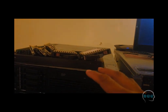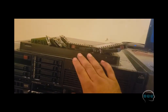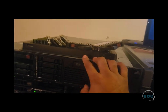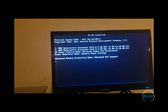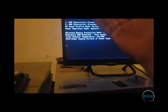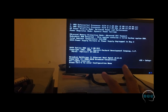For virtualization to work, your server needs to support it — the CPU has to have the virtualization feature enabled in the BIOS. This allows you to run multiple operating systems on top of it. If the server is too old it may not support virtualization, so do your research before buying. We have two CPUs, advanced memory mode is on, and 32 GB RAM is installed. The first thing we need to do is go into the BIOS to check if virtualization is enabled.